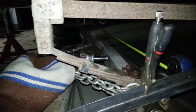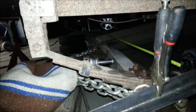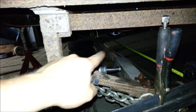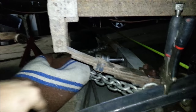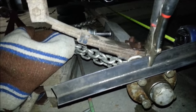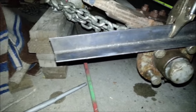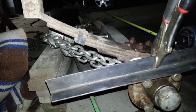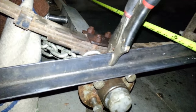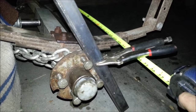So you can see the contraption. I decided I needed to bend it a little off-center, so I got it chained clear over to that leaf spring, and then chain wrapped around the middle so I get an even pull on each side. It's bowing right there on the brace. I attached a piece of flat iron around each one. I got a nice long handle to keep myself away from the jack. Measuring it, it was roughly about an inch out.